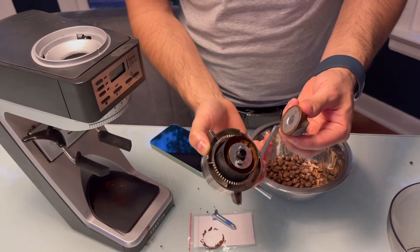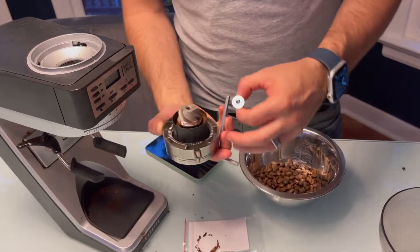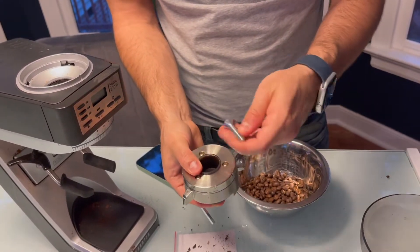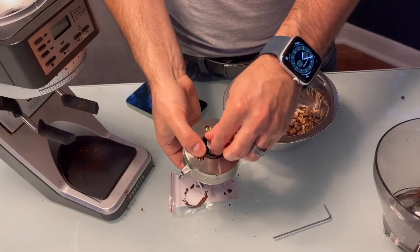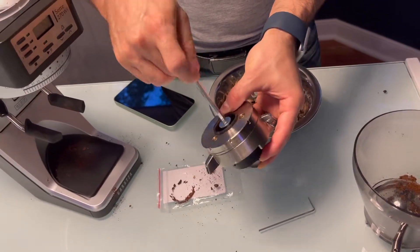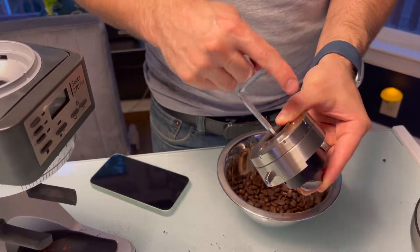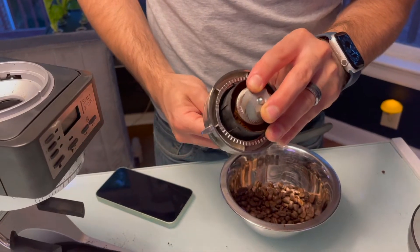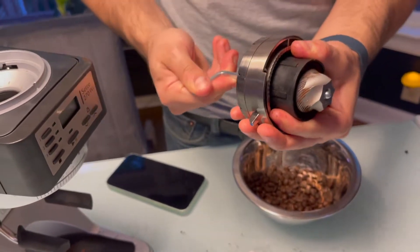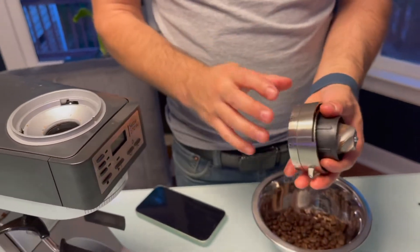It's going to line up exactly with those screws. Hold this on from the bottom, put your screw back in. Give it a couple of turns and then start working it in with the Allen wrench. Once this screw comes to the bottom and you start to feel it getting tight, switch to holding this part again and don't overdo it. Just give it a nice firm push — once it doesn't go anymore, you're done.